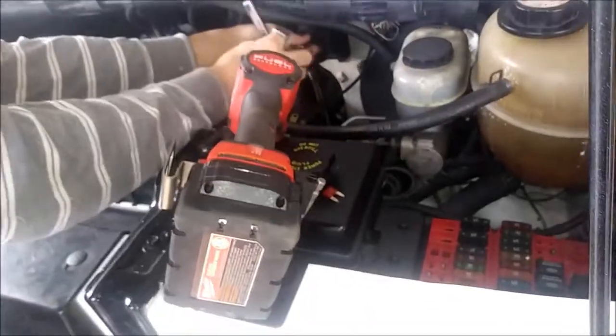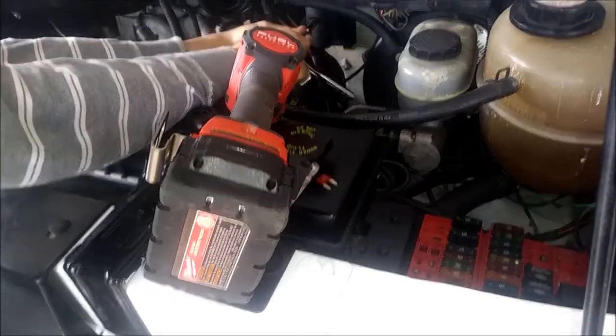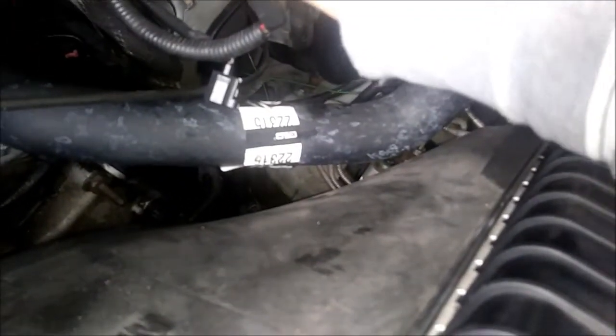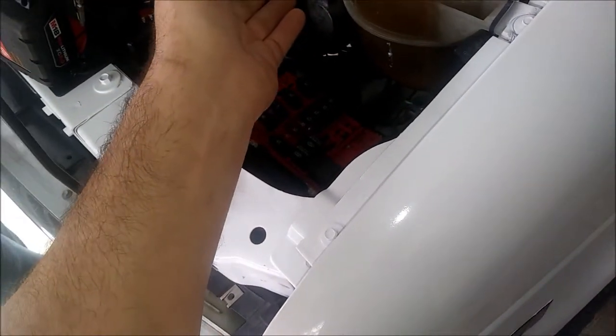It's my understanding that really all you have to do on these computers is match up the engine and transmission. I don't know if accessories and all that really matter, but I think you need to stay within a relative year. They say different programming codes do various different things. If you've got extra sensors or a three-valve engine, it's different. So we got the computer loose here. What you want to try to do is match up your engine — 5.4 liter two-valve, that's what this is. It doesn't matter what year range as long as you have all the basic sensors, like your throttle positioning sensor. If you have a three-valve with cam phasers and stuff like that, that obviously wouldn't be a match.